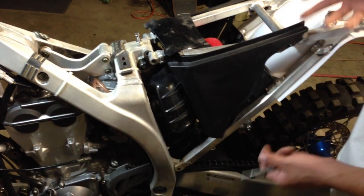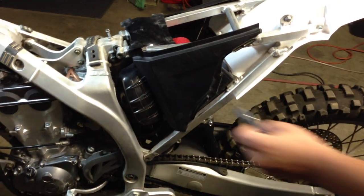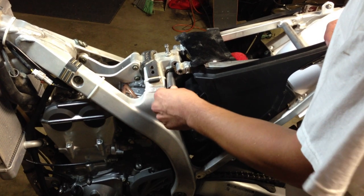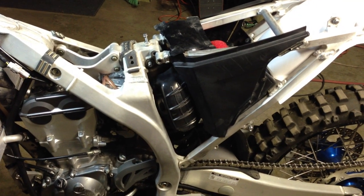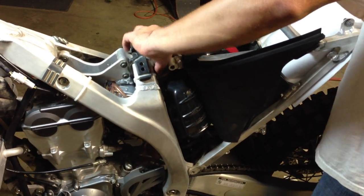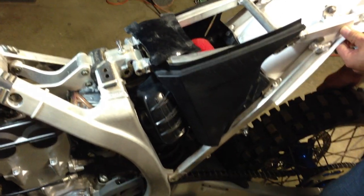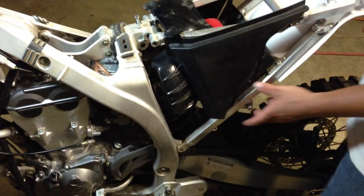You can choose to pull it out if you'd like but it's kind of a hassle. So if you simply take the rear shock top bolt off, it saves a lot of grief trying to get this thing off. You pull the tire up and it relieves the stress on the shock. Pull the bolt out and now let the suspension sag. Now removing the airbox is a breeze.